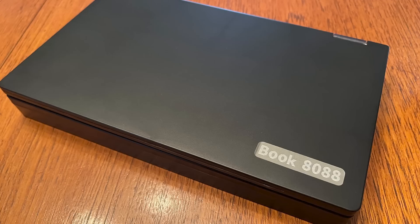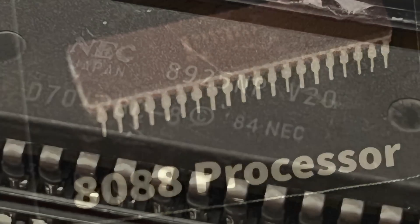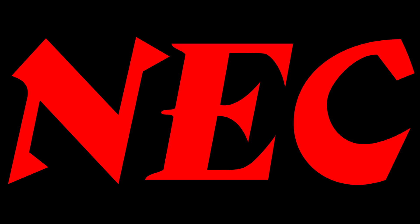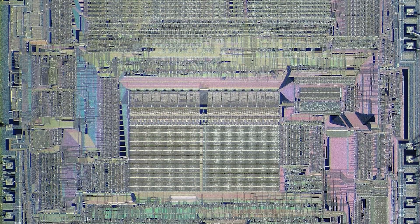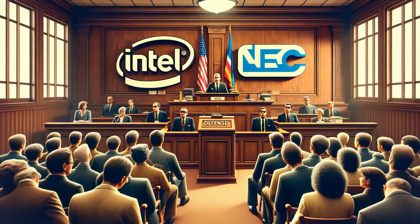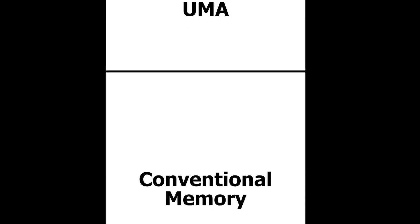Really, what we've got in here is the same chip that launched the IBM PC revolution. Only it isn't, because what's actually in this 8088 book is an NEC V20, which is a pin and opcode compatible CPU produced by NEC and heavily scrutinised by Intel because it was very, very similar, resulting in two legal sessions. The first was settled out of court and the other found in NEC's favour. So right off the bat, this is actually a V20 book. For memory, we've got 640k, which will provide a limit to what can be done on this machine.